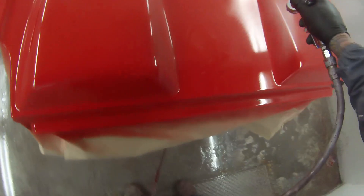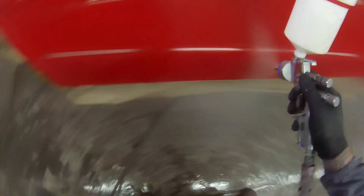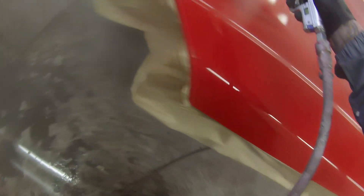The reason I chose the RP over the HVLP is because of its versatility. Again, it is a conventional air cap, so you will be able to replicate both the European and Japanese finishes a little bit easier with it. I find it does put a hell of a lot of paint on, so you may have to wind that fluid in if you were to try and get a Japanese finish. Also, thin the paint down a touch, move a bit quicker, and put a little bit less material on. But in that situation, I would simply change over to the Pro-Lite and use the gun to suit the finish I'm looking for.